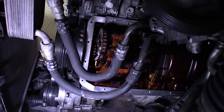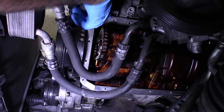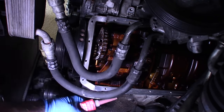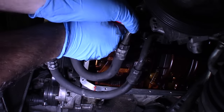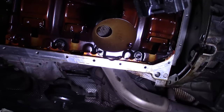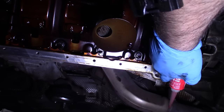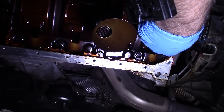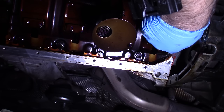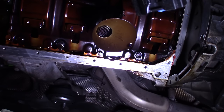Make sure you take the O-ring out of the dipstick tube hole and put it on the dipstick tube. This is the front of the engine — you need to put some RTV where the front cover joins the rest of the engine block, those two lines. I'm going to put some red RTV on those. You can see where the seam is where the block joins the transmission — just put some along there and along the other side.